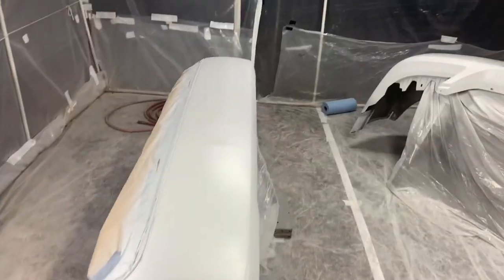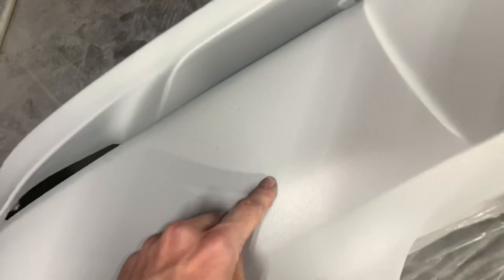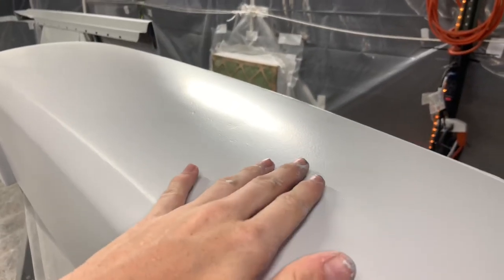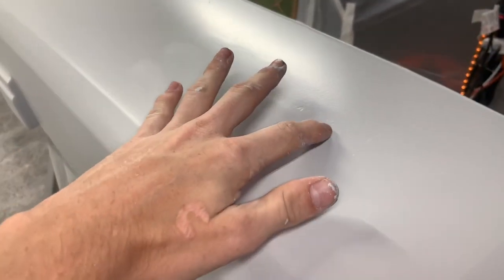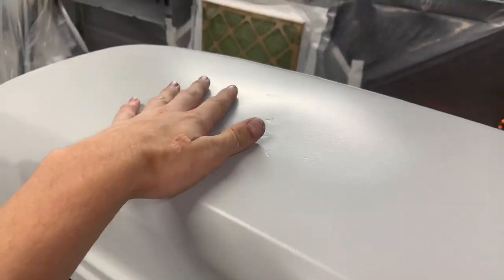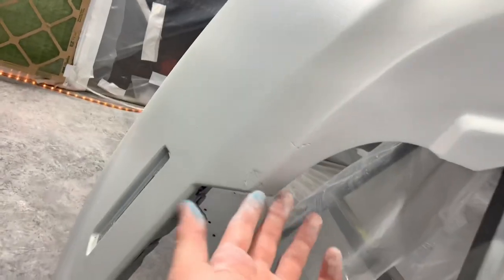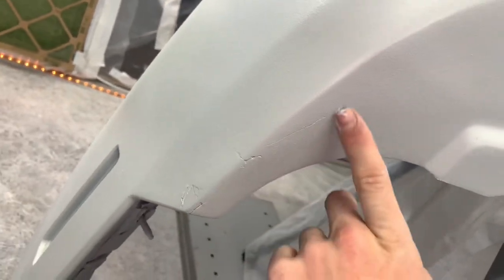There are a few areas that we need to do some body work. We knew there was a crack in this — we were just testing to see what this primer would do because it sprays on pretty thick. But you can see there's a line there, so we're going to have to grind that out, fill it in, and then spray it with some primer again. A little bit of Bondo is showing through the primer. There are little divots here we're going to have to fill in with some red putty. There's a pretty deep one that's going to need some Bondo, and it's just cracking really bad, so we're going to have to fill this stuff in a little bit.